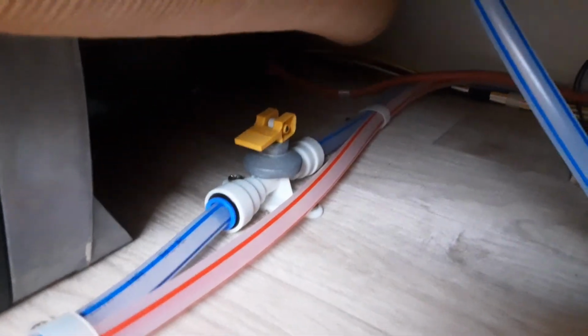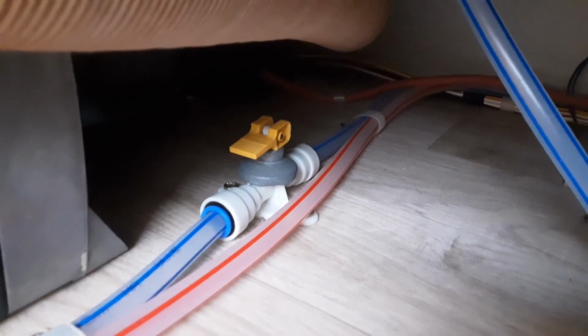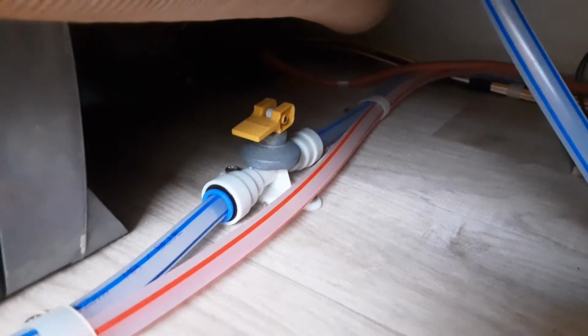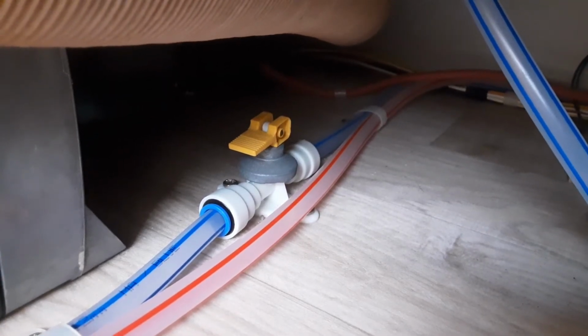With your aqua connected on the outside, you can go over to the control panel again above the door. Oh, sorry, before we do that, we're going to check to make sure the drain down valve is shut underneath the seat on the far side of the van, which I can see it is. That little valve there is the drain down and fill valve. So essentially, with the position it's in now, you could fill the water system on board the van. If you lifted it up, the water would come straight back out the bottom of the van, and that is where you drain down the caravan for winter storage.